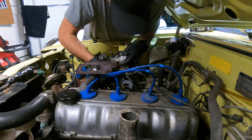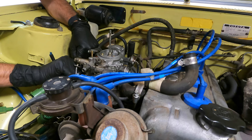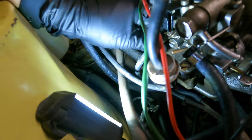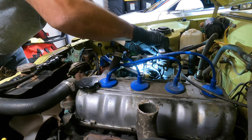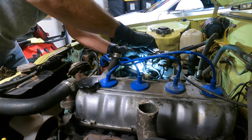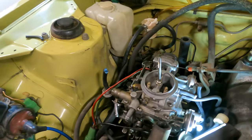Good news is I found a couple of sticky things in there — not sure that's going to be the problem, but I did clean out the jets, cleaned out the little plunger, and made sure everything was moving around. There was one stuck part for sure. Considering these things were hand-tight before, I'm not going to crank them down — just make sure they're nice and snug. Now we're going to use our pictures and get all the vacuum hoses back on and get this thing back together.